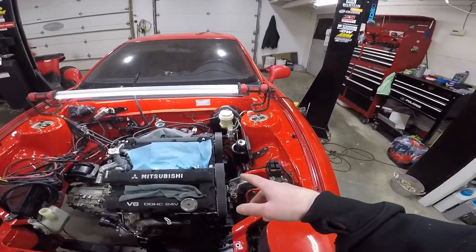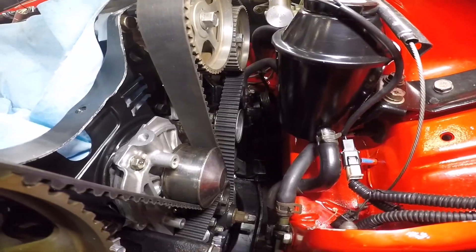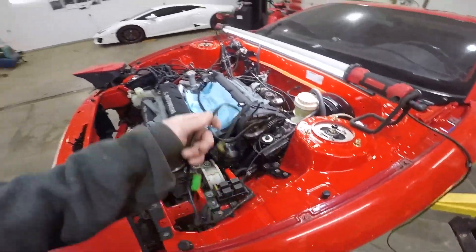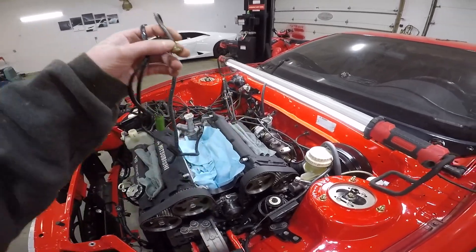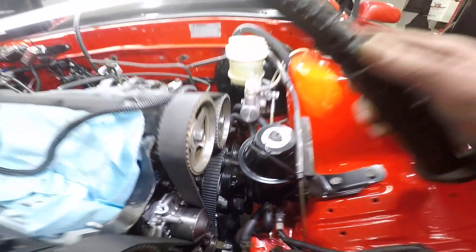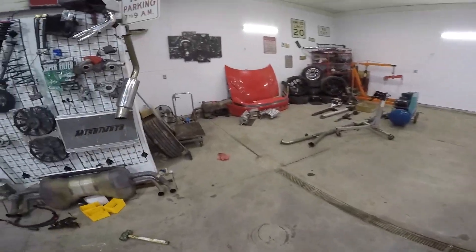I gotta do this power steering pump and pretty much all these pulleys over here. There's no way for me to record it — you guys aren't gonna be able to see. The power steering pump gets held on with two bolts. Gotta get the tensioner pulley on, which you can't really record either. Real quick tip: I would run this wire before you completely bolt that in — it goes to your oil pressure sensor and your power steering pump. You'll never get it on if you don't; it's a pain to try to get it on once it's all tucked back in there. Got the power steering pump on, got the tensioner pulley on but loose so I can still move it. I think I'm gonna put the alternator on next, though I like making my life hard.